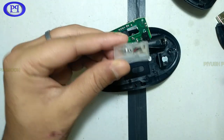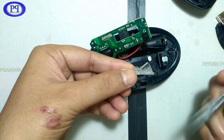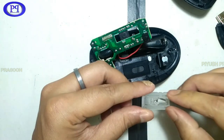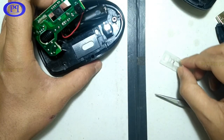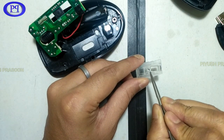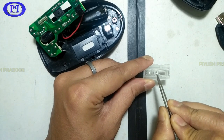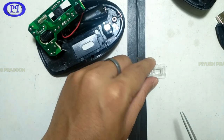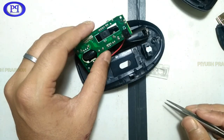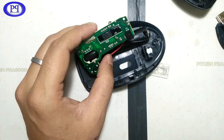So if it is emitted from the LED, it will just enter into the channel here, and further it will be bent as per channel design and come out from the channel and fall on the surface incidentally. So whenever you are moving the mouse, that surface will reflect those lights towards this lens, and further the light will be converged by this lens so that the sensor could receive it properly, due to which the sensor is detecting the movement on the surface.